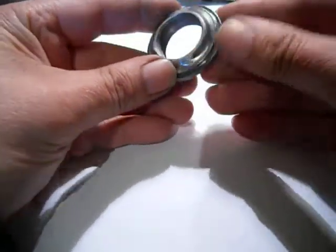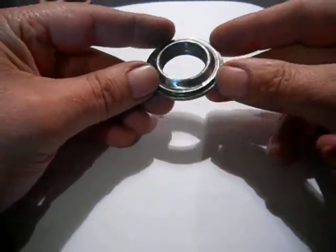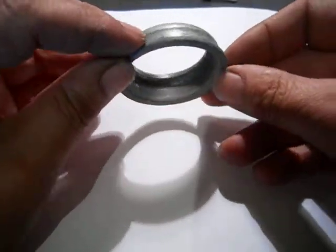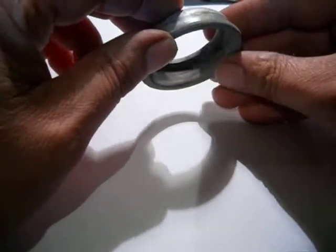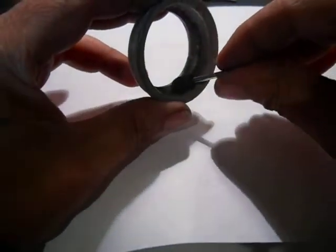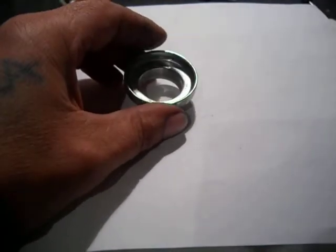I don't know if anybody can see that. This hasn't been done yet, right here. The same applies for your sprocket bearings. I just wire brushed that. Trying to get where the camera can pick it up, just in one spot. I have saved these by doing the same thing — taking this emery type bit and polishing that. I've saved wheels. I saved an expensive BMX wheel one day because the bearing was just destroyed. They stuck the bearing in backwards. People make mistakes. But I did save it for the guy.